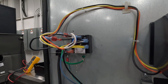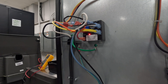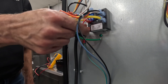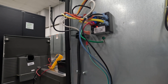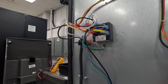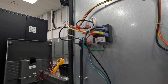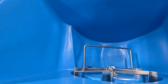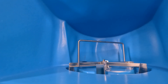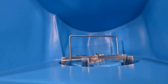Once we get into our agitation timer, as you can see, there's actually something labeled as the test for the agitation. We're just going to simply remove the red wire, at which point we're going to watch the red LED. The instructions are on a decal right there on that dispenser. It should change to a different flashing pattern and it will also agitate for a few seconds. It's going to do this three times. That tells us the agitation timer is indeed working and this is not why we're freezing up into a ball.